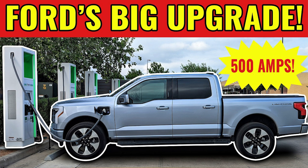Power is a function of voltage times current. For example, I also have a Chevy Equinox EV, which has an extraordinarily low battery pack voltage. That forces GM to have it pull 500 amps for the first 15 minutes of charging just to charge decently — and it barely does. That creates a lot of heat, causing thermal derating. You'd rather push the pack voltage up than the amperage.